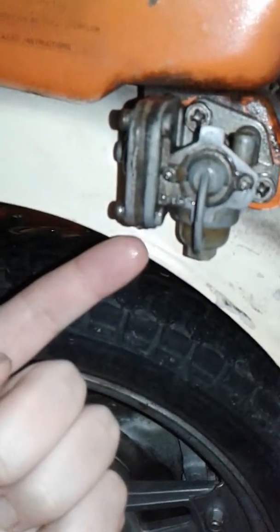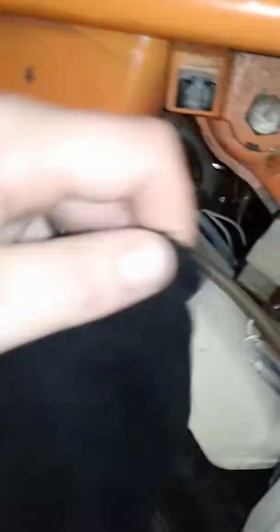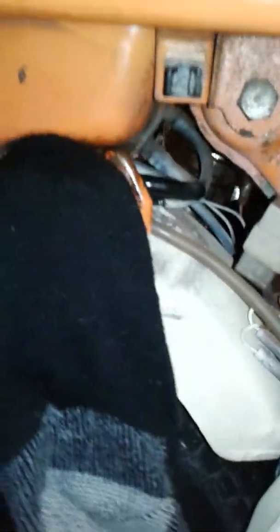I'll be ordering a gasket for that. I have a sock on the fuel cock because it's leaking — it's the diaphragm and side of it that's leaking. I've got a suspicion that there is a busted O-ring in there, so we'll be taking that off and having a look. I've got a sock on it because I don't want it dripping on my carpet. It's easier to throw out a sock than a piece of carpet, isn't it?